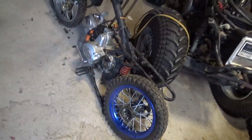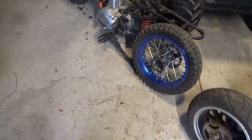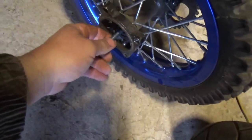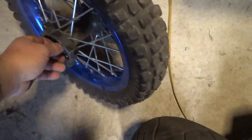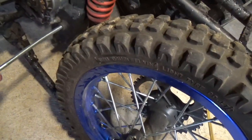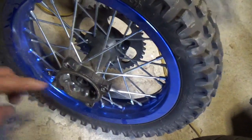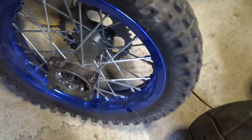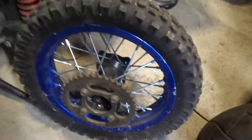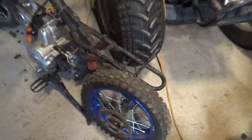What was wrong with it was it had this back tire on it, no sprocket. It was using this as an axle. Anybody see the problem? And it was using a second one of these as a swing arm pivot. Once again, any issues? For spacers on the axle, they were using 1/2-inch Craftsman sockets. Install this the correct way, and there it was. So that's the way I got it, and I paid $80 for it.